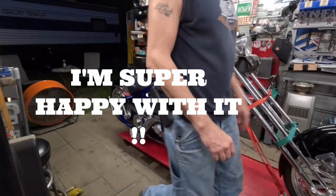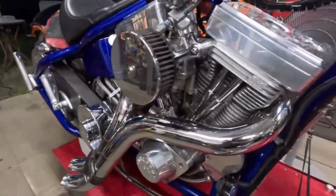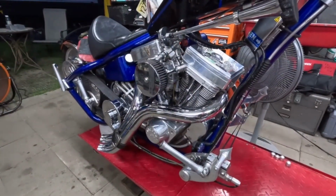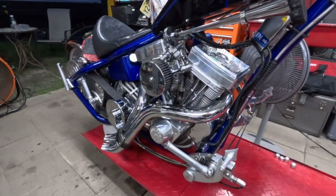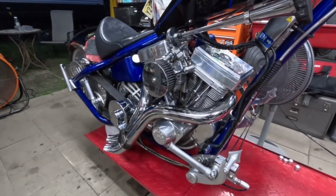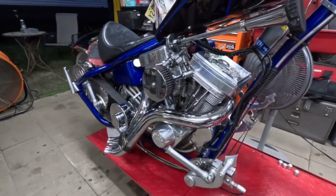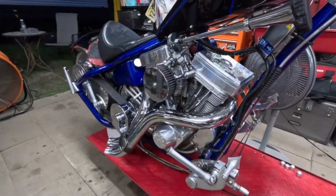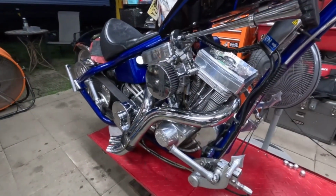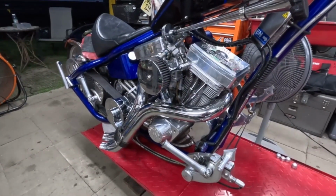That's it. That's the second heat cycle. The most important thing you got to worry about during the break-in procedure is heat. It's very important not to crack the throttle, go real heavy with the RPMs. You do the heat cycle for 4 minutes for about 4 times, and then you get on the road and do your break-in procedure.